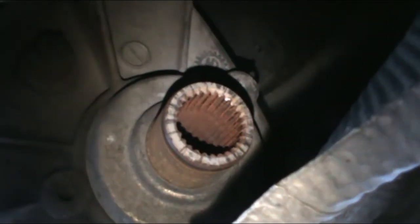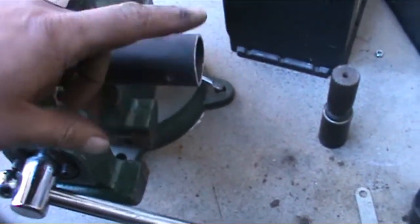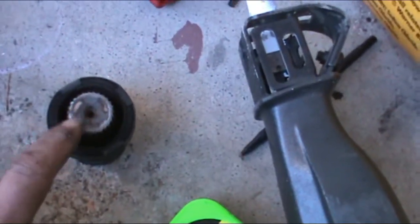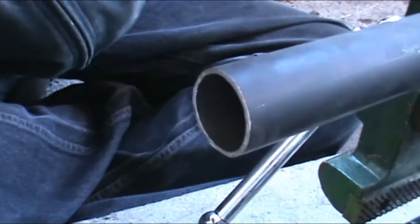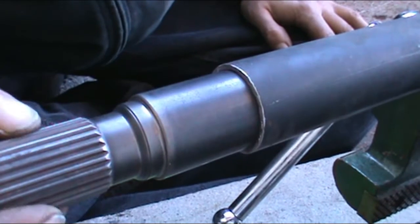I'm going to get to cut my shaft, get the new one welded on. Got to do the measurements. What I did is took the saw and cut the front of it off and measured it out — 29 and 1/8 inches. That is going from right here — flat spot — to the tip of this. I put this on here flat as a reference, so this end comes to 29 and 1/8. The new part, when I get it in here, I'll make sure I measure it out. Right now I'm just going to take my file, clean it up, make sure it's all nice and smooth, and then clean the inside out. I got it all cleaned up — no burrs, nice and smooth.